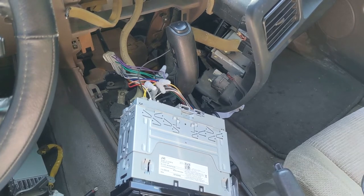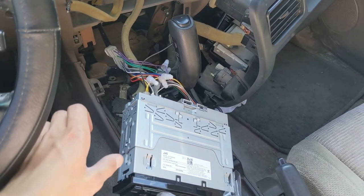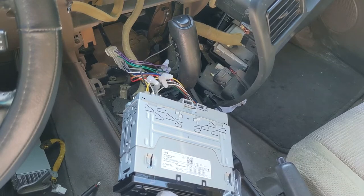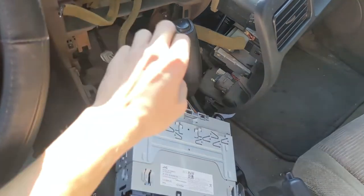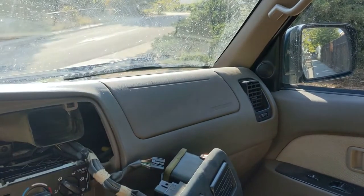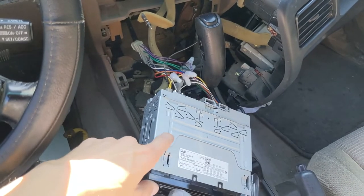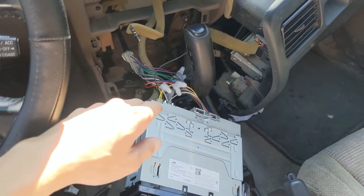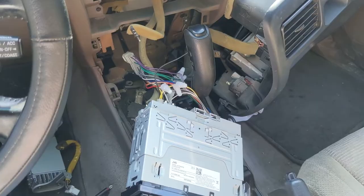It's not just the placebo effect. I was able to turn up the volume and it didn't even clip. The old receiver always seemed pretty quiet, so I personally think this highly likely has more RMS wattage per channel — because I was able to turn up the volume and I didn't get clipping, whereas the old one would start clipping at higher volumes. I don't know if that's a short supply of power per channel, but this was definitely worth it after just 30 seconds of playback. The only other issue I need to resolve is that the antenna is always up when the car is on. On my old aftermarket radio, if I put the source to radio the antenna would come up, but if I was listening to a CD, Bluetooth, or any other input it would come down. I need to figure out if this radio is smart enough to control the antenna based on the input source.